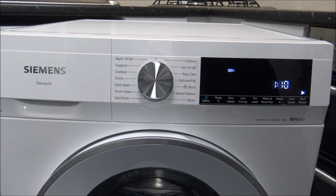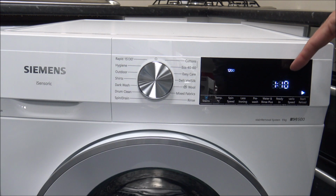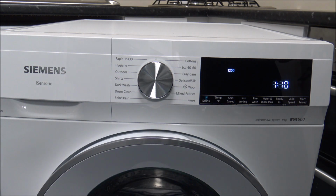But this is something that's really good, the drum clean. As I say, it takes an hour and 10 minutes, so it's a fairly quick wash to do. I'd recommend just doing it on its own. Don't put any clothes in it. There are different detergents, tablets and powders that you can use. I'll pop a link below, because there are others that we recommend that quite a few customers tend to buy now to keep the machine clean.